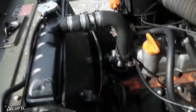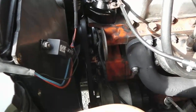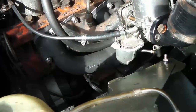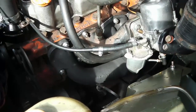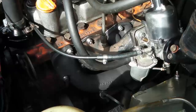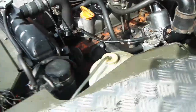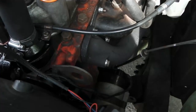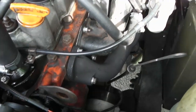All the coolant hoses have been replaced. I rebuilt a water pump myself — I've never done one of those actually — and that appears to be fine. New thermostat housing, new fuel pipe. I had the manifolds off and replaced the manifold gasket. I've used one of the HNJ Engineering graphite gaskets and that seems to be very good. All proper fixings for the manifold now.